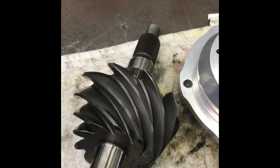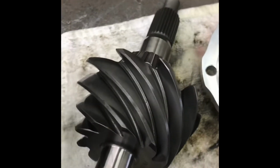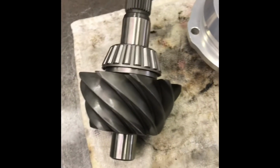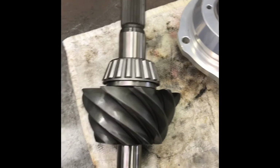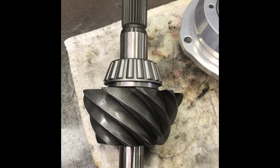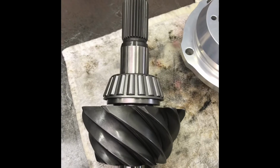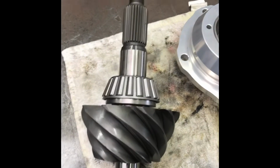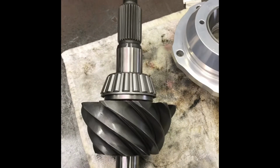So of the 4 methods, I often wondered if they're running on this big elaborate machine, and for instance, if this didn't have any numbers on it, you measure your head thickness, you look up the master housing dimension. All rear ends have this universal, well, it's not universal, when they spec out a housing or they build a housing, this is some kind of nomenclature they have, and that's how they work from. They work off that number. So in this, if you didn't have any numbers, you'd measure the head thickness, you look up that master housing dimension, your actual installed height, you do the math.